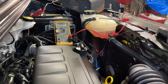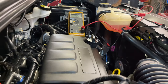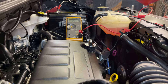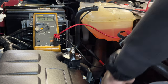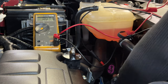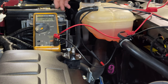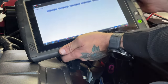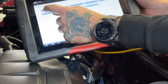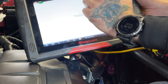I've got the cooling fan harness unplugged down there. There are actually three circuits to this thing — three different fan speeds basically. What I was doing is using the scan tool, going into functional test outputs, and cooling fan relay one, two, and three. This turns on all three speeds at once, so just going to turn that on — you can hear the relay click.